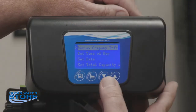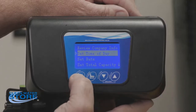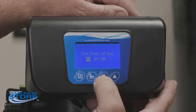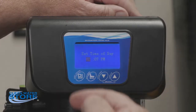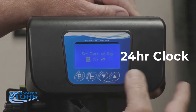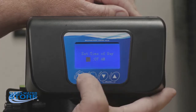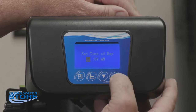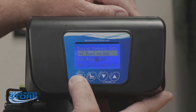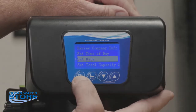Push that and you've got company info. Scroll down to time of day. Push this button and scroll up and down to set the time — 1 p.m., 2 p.m. Note: if you want to go to a.m., scroll all the way to 12 and then back; it'll go to a.m. starting at 1 a.m. Set this for where you want your time, then go over to set the minutes. Push it again and you go back to your programming screen.